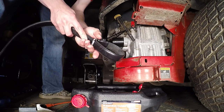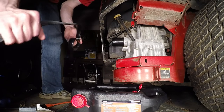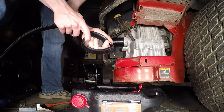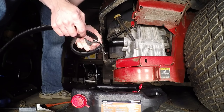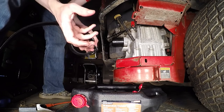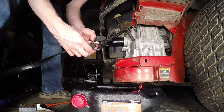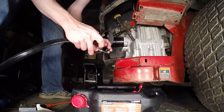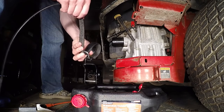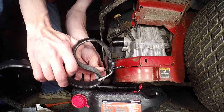This is basically going to work just like a strap wrench, except the wrench is just going to be us pulling on the end of the belt to twist it. The direction of pull is going to be the direction the buckle is facing. Lefty-loosey — we want the filter to turn this way, so we want the belt to go on like so, so that when we pull it's going to cause a counter-clockwise motion.